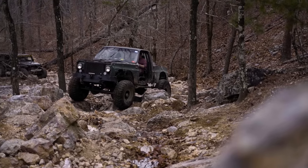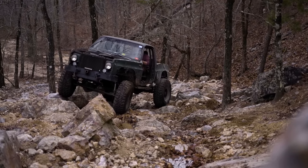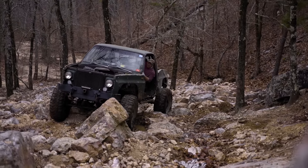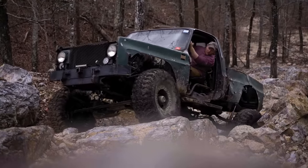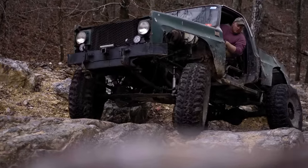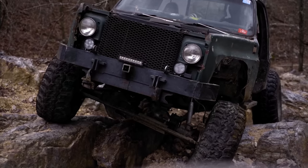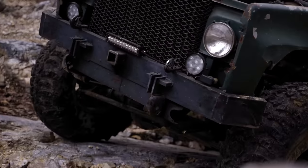Even if we left everything else stocked throughout the axles, we're still going to need to re-gear them to have a fighting chance at getting the engine to spin the tires more effortlessly. But re-gearing your stock axles to run 40-inch tires is like stepping over quarters to pick up dimes — or like washing your vehicle in the rain, unless it's completely covered in mud. If you plan on building your rig to actually use it for off-roading, the only good way to keep it from exploding on you is to either spend a lot of money repeatedly to beef up the current axles, or spend even more money once and build the right setup the first time.